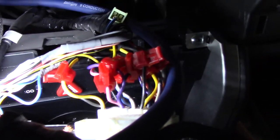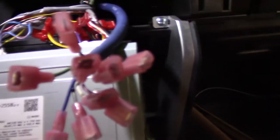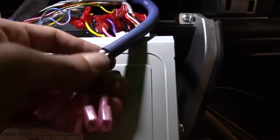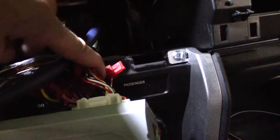Giving an update: I got to run a nine-pin plug or wire from all the speaker wires up, down, back, around, and behind me. Got all four speakers tagged in, and all I have to do is dig down the remote wire and tag it in for the ninth pin. The reason you have nine wires is four sets of speakers — that's eight — and the ninth one is your amp remote, which is just an accessory I tagged off up in here.